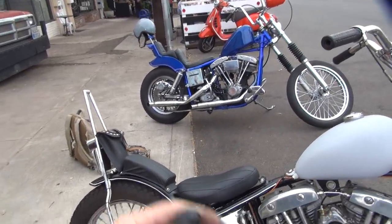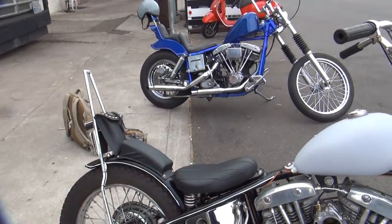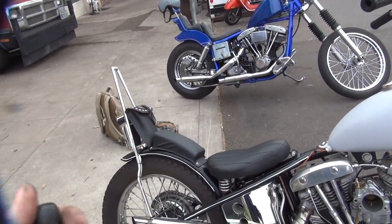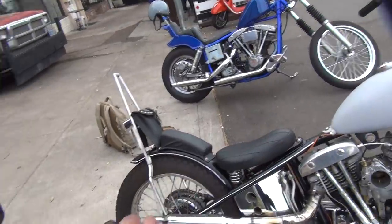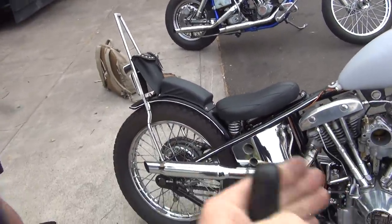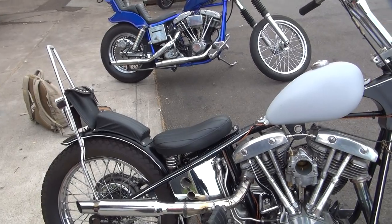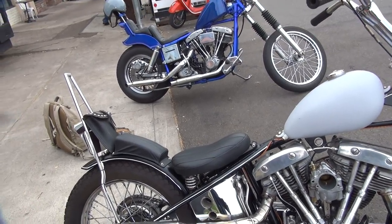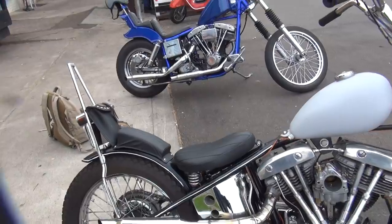The accelerator pump is for when you're rolling onto it. That's the accelerator pump's job, to fatten up under load conditions. But the low speed jet, if it's the correct one, will carburate right through there with no hesitation anywhere. If it's too rich or too lean, it stumbles a little bit. Once it's off idle and going, there's no hesitation. It's only right off idle, which is the low speed jet. Yeah, only when it's moving, when it's actually under load.